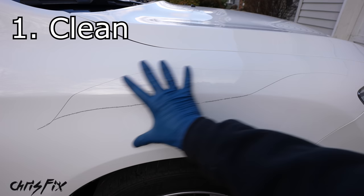Once you're happy with how your touch-up paint came out, the last thing is to apply clear coat to all the parts we touched up. First, wipe down the panel with isopropyl alcohol to remove any dust from sanding. Then add thin layers of clear coat — start from one end of the scratch and work to the other. It's difficult to get clear coat on smooth with a brush, so don't worry about how it looks — just make sure you have a complete layer covering the touch-up paint with a little overlap on surrounding factory paint. Apply a second coat after 10 minutes for a total of two coats.